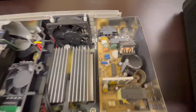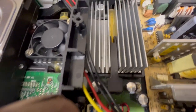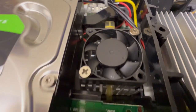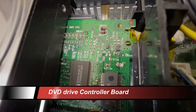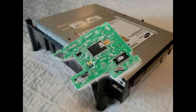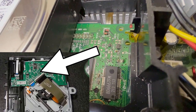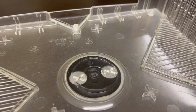The decisions I made: the standard hard drive and standard power supply stay in there. I changed the fan at the back because it no longer fitted — I dropped it out of its case and cable-tied it to the back. A lot of the early ones came with a fan on the processor, but I decided to add a fan to the heatsink as well. There's the DVD controller board — I couldn't find any other way around it to get the system slimmer, so I took the DVD controller board out of the drive and bridged the pins for the contacts that showed whether the drive was open or closed, so it permanently thinks the DVD drive is shut.